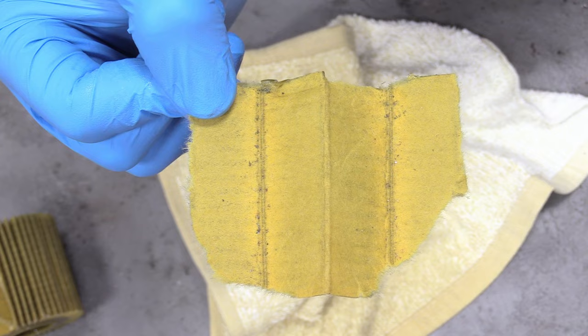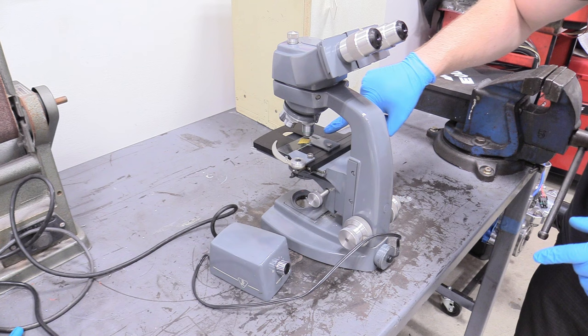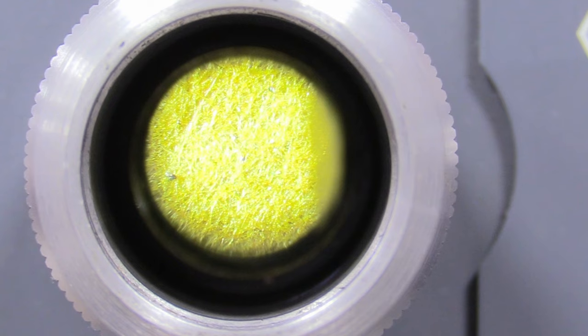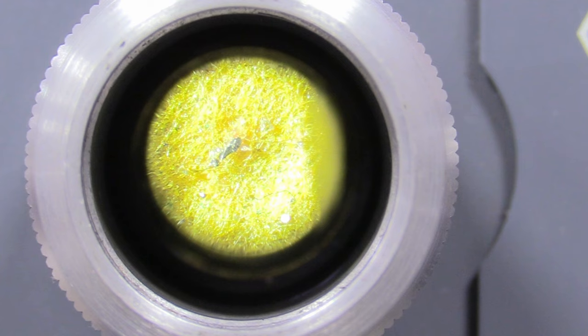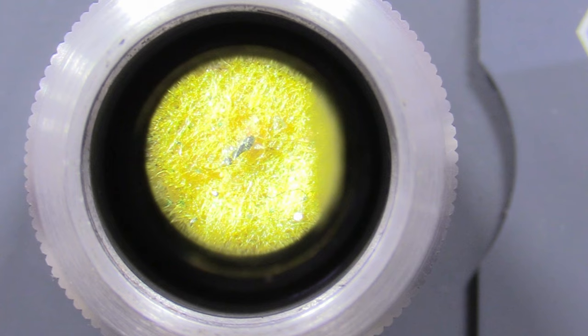So the plot is thickening. I've borrowed my uncle's microscope — this is a serious piece of kit and it's going to show us exactly what is on our filter material. I've already cut a sample off and put it on the deck. We have the filter material under our microscope and it sort of looks okay under standard magnification, but if I scroll over to the left — look at that. That's quite a bit of metal in there. Stuff like that could easily ruin your engine if you don't get it out of there quickly, which is why all the old guys have always told me to change the break-in oil. Upping the magnification, you can really see that piece — it's quite large, bigger than I thought. That is some pretty clear evidence that the old adage is correct.